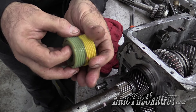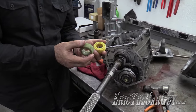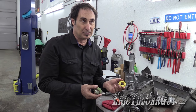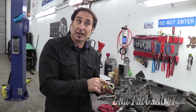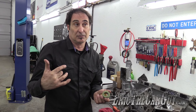With that information, how does it translate into the speed range? They have equations and formulas online where you can plug in your tire size — like a 255/60-15 tire with a 3.55 gear and a seven or eight tooth drive — and it'll spit out what driven gear you need. On GMs, it's called a pencil gear.